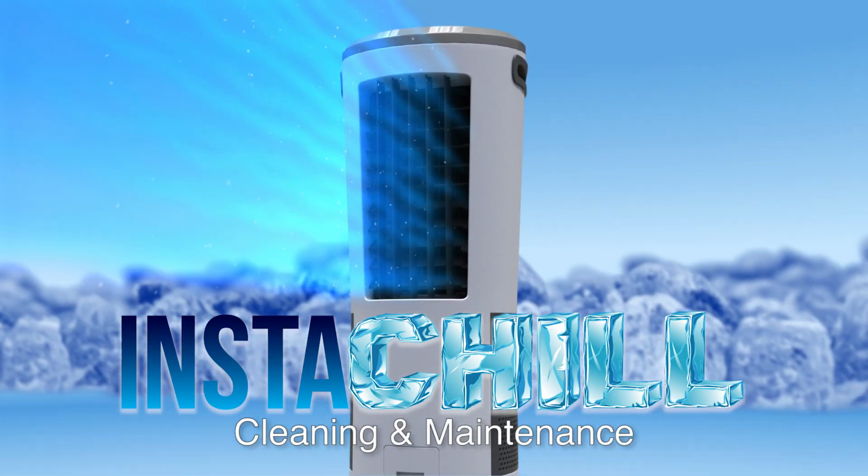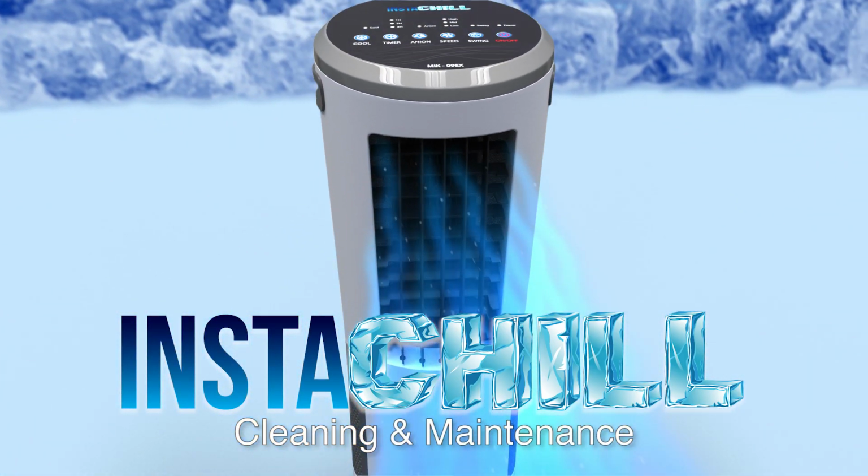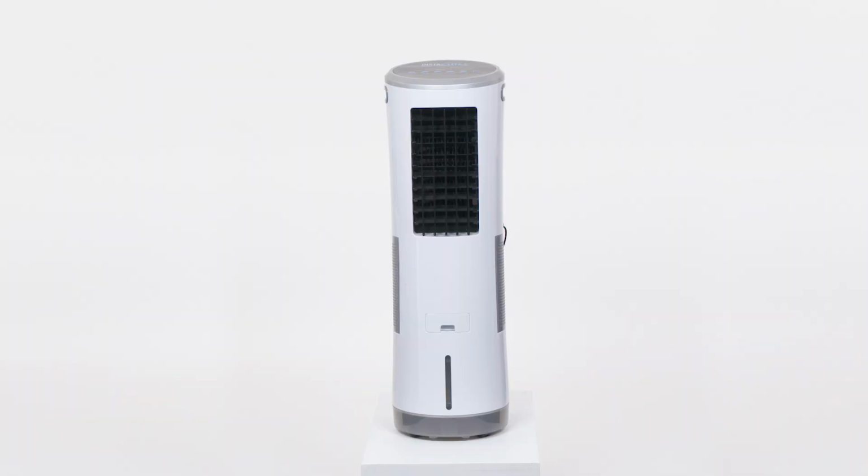Now to look at cleaning and maintenance for your InstaChill 09EX. To minimize the cleaning required, you should drain the reservoir after you're done using your InstaChill. This will help prevent algae forming in your reservoir. Also, it means you will not mix your cold fresh water with the warm stale water from previous use.